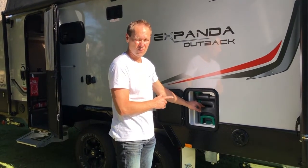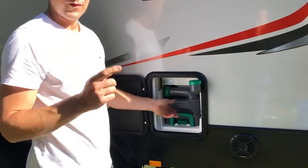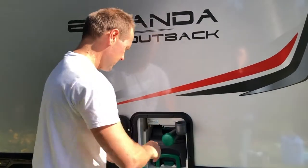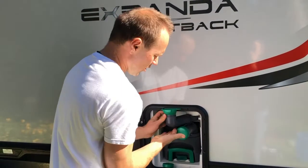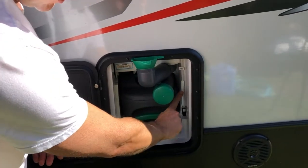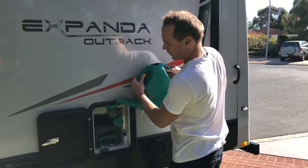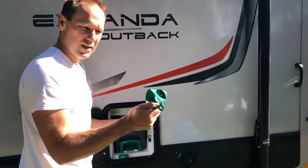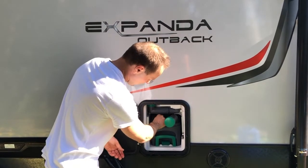This is a self-contained system so it's got its own flush water as well — I'll show you how to fill that. There's a neck just above there that you slide out. Get the little funnel out, flip that open, grab the funnel, undo this lid — this one's clean so you don't have to hold your breath. Attach the funnel, tilt it to make it flush with the wall, and push it down — hold underneath because it's flimsy. There's a little pipe on the right with a max marker, so fill it up to close to the maximum. Don't go over because it'll spill and create mold. Make sure you don't lose this funnel — when you're done, put the lid back on and fold everything away.